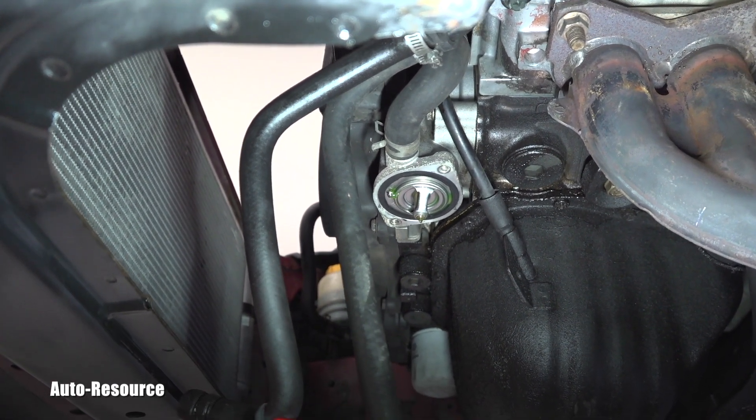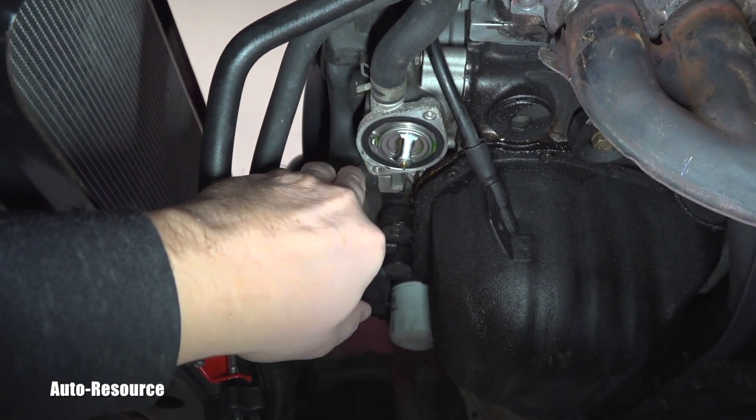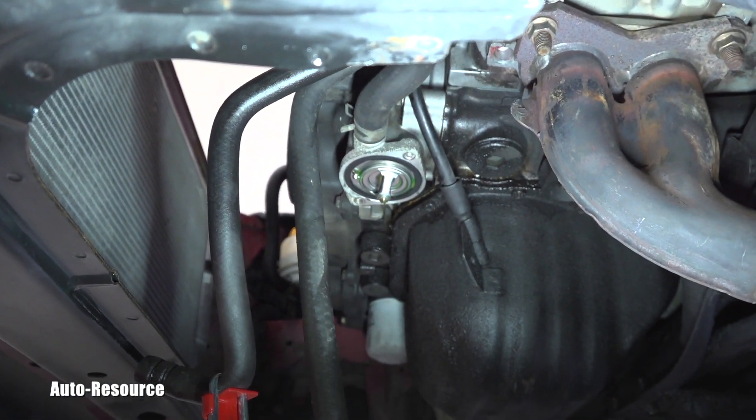This is the incorrect way — that small jiggle valve right here is supposed to be in this orientation and this position. You might say everyone knows that, but that's not true. There are so many forum questions about this. If you search Google, people forget to check this and there are huge discussions about which way it's supposed to be oriented. As you can see here, this is the right way on this engine.